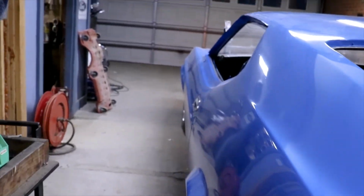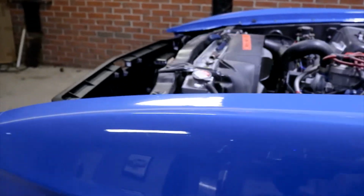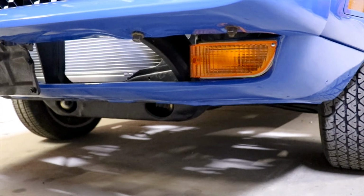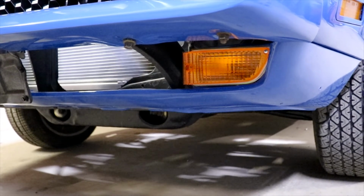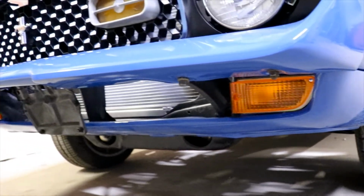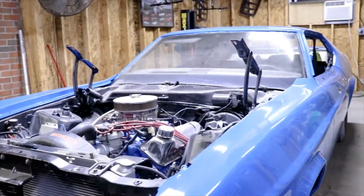So I'm thinking those lights might be the issue, the new turn signals at the front, down at the bottom. Because when I got the lights on, they're real bright, like both elements are lit up inside. And usually it's supposed to just be one until you turn the headlights on and turn the turn signals on. So one of them's supposed to be kind of dim with the turn signal on, while that one element is dim, the other one's actually flashing. But I'm getting a straight, steady light, real bright, almost like your brake lights, if you're riding with your brake lights on all the time.